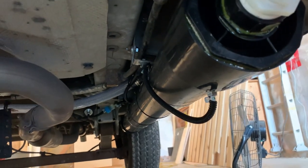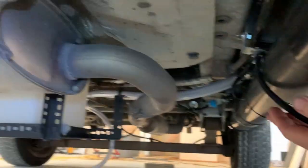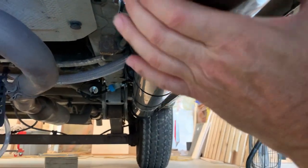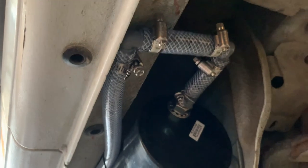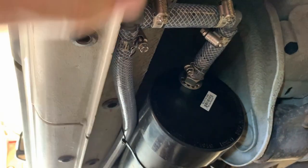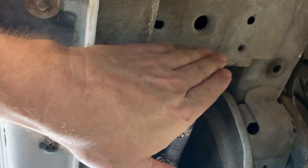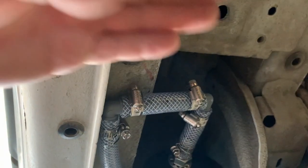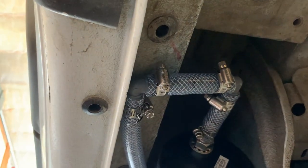Very successful day. I now have the loom covering up the fuel line. The fuel line sticks out a little further down than I'd like — actually not quite as far down as the water tank. I am going to build a little rock guard for this tomorrow — a shield that comes around here and just covers that up, so if it gets hit with a rock it won't be damaged. I'm right in front of the rear left tire, so I'll go into the frame here and build a little aluminum shelter for any kickback. I don't know if it's needed but it won't take much work — I'm pretty good at bending metal.